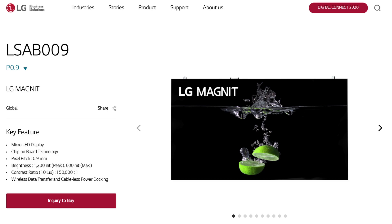The reason we're seeing a display this large is because it's made up of individual modules — the LSA B009 — running at a resolution of 640 by 360 each. If you get really close to them, you'll be able to see the lines where the individual components meet together. At demos they always block off the front of the TV so you can't get that close. That's one reason this technology isn't quite ready for home use. Looking at the specs, the pixel pitch is only 0.9 millimeters, which is really more in mini LED territory than micro LED — so this feels more like a marketing scheme than true micro LED.